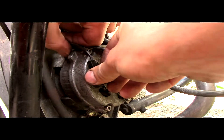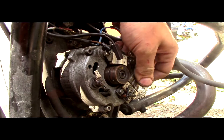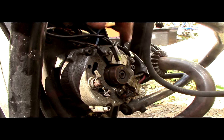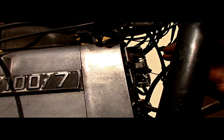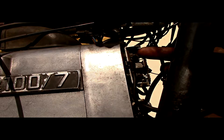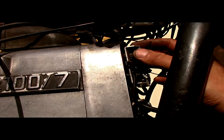Y doesn't want to come off — there we go. And the three-phase outputs, which are here. With all the wires clear from the stator, you can take off the diode board. It's taken off by undoing these four bolts here — two on this side, two on the other side. It's an 8mm.